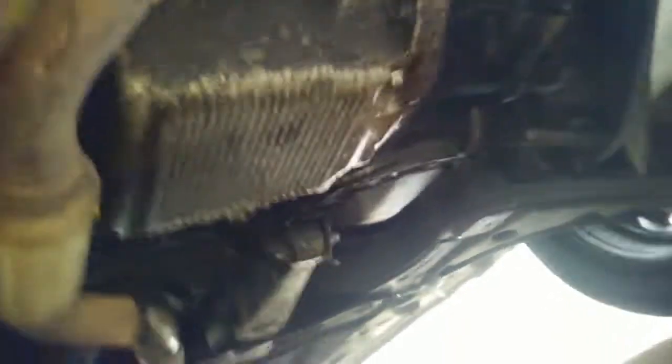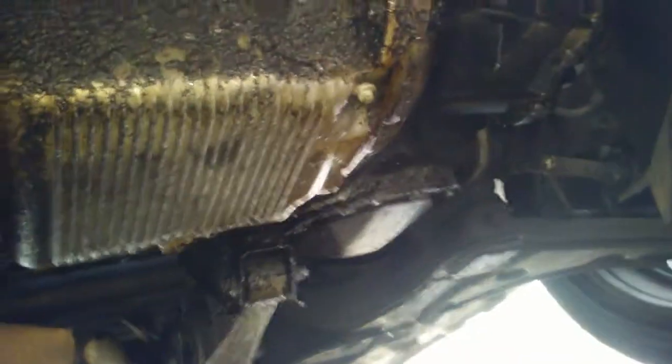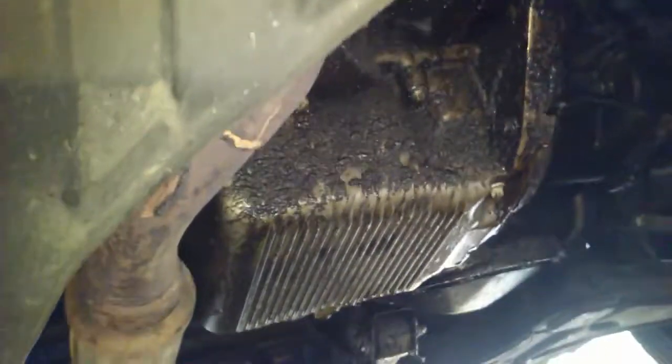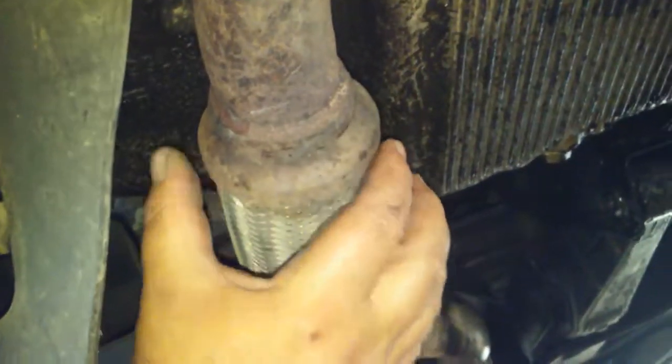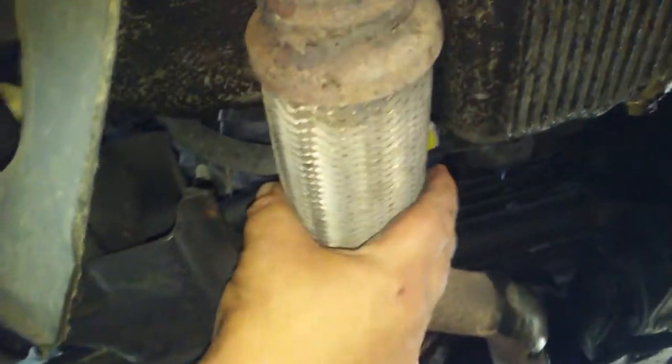Your brake assemblies seem okay — no damage, nothing outstanding. Your wheel bearings, like I said, I've had both sides up and worked, and they've got no slack in the wheel bearing assembly itself, or in the lower ball joint, or in the upper strut assembly. There doesn't seem to be much play there, or in the torsion rod and its link tie rod ends — maybe a little bit of play but not much, not enough to cause an issue. The big source of any noise you might have is the flex pipe, which is shot.